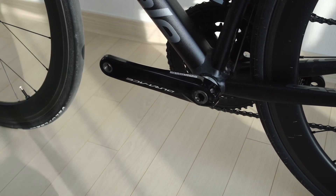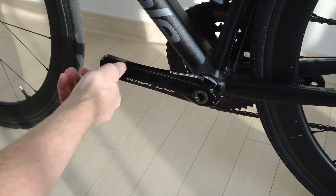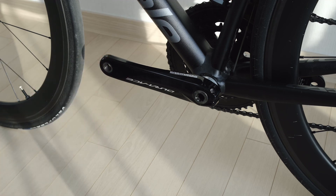The way I've been able to remember it: on the drive side, crank at three o'clock, turn it clockwise towards the end of the crank arm. On the non-drive side, crank at nine o'clock, turn it anti-clockwise towards the end of the crank arm. Once you know which direction they go on, it's so much easier to remember how to take them off. Thanks for watching, I'll see you next time!